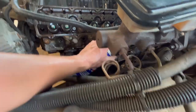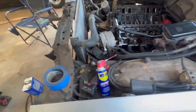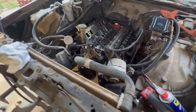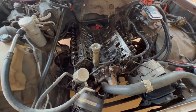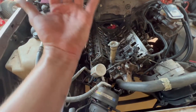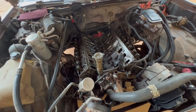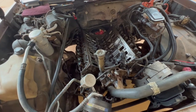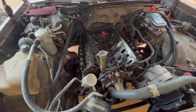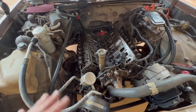I'm putting WD-40 down our spark plug holes so we can turn the engine over and make sure we don't develop any rust. It was kind of warm today — I was sweating out my gloves so I took those off for my final torques, and that's why I'm really worried about sweat and salt getting on this fresh metal. A lot of hard work went into cleaning and we don't want to double our work with more corrosion.